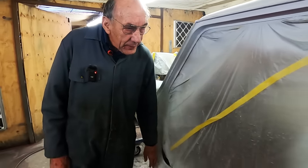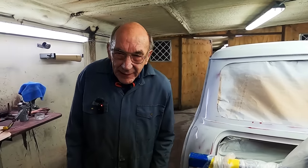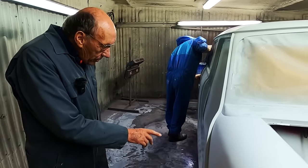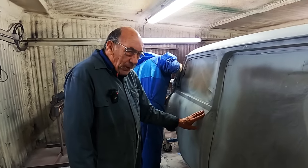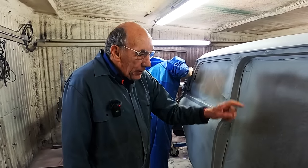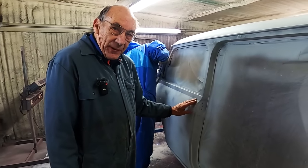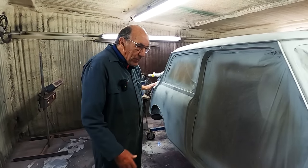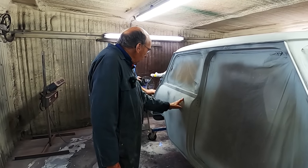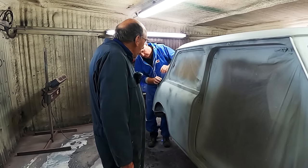Get it done's the thing. This is the byword of this car: get it done. See this here, look, you'll notice that this has got this sort of black overspray on it, and that's just a puff, so that when you're flatting it, you don't miss anything, because unless you've rubbed that off, you ain't flatting it. It's called a guide coat. I mean, all the people in the trade know about that, but not everybody who watches our channel is in the trade. So there you are, that's a guide coat. And that'll all get flatted.